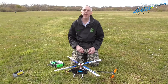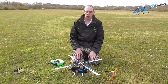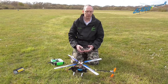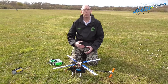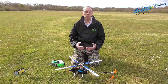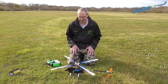You may have noticed during the flight I was talking about the head speeds. We started off at 1200 RPM and the model took off beautifully — very nice to fly at 1200 RPM, relatively loose, which is quite a nice style for scale flying. You don't want the model too locked in. As we increased the head speed from 1200 to 1400, the model became more stable and more solid in the hover. Then finally we increased up to 1600 RPM and it became even more solid, locked in, and more responsive on the controls.